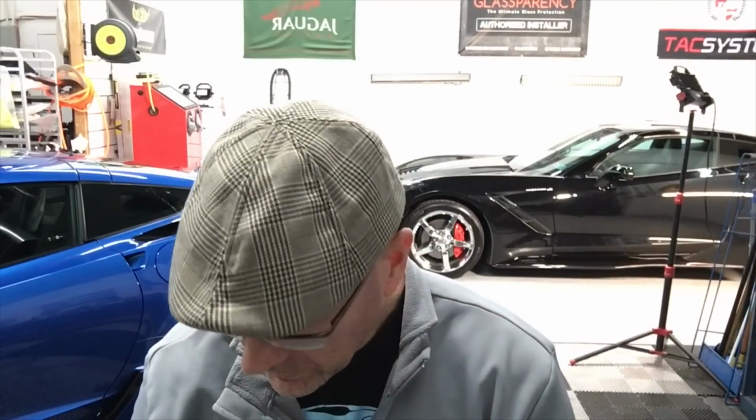Okay, Mario Mifsud has a ceramic coating on his car, and he might have messed up a little bit while applying it. And hey, it happens to everybody. You live and you learn for next time. To straighten that out, if it's fresh, you should have no problem whatsoever using a cleaner polish. If you had caught it sooner, you could have reapplied the coating, which reactivates it so you can remove any high spots or streaking. But if it's still fresh, 24 or 48 hours out from when you first applied it, just grab yourself a cleaner polish, something very mild, and that'll take care of it. If it's been there for quite some time, then you're going to have to use something like maybe 3D One, something a little bit more aggressive.